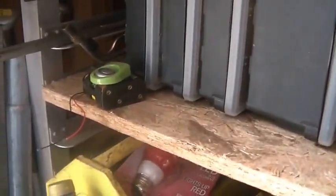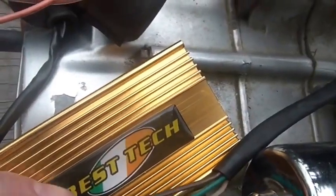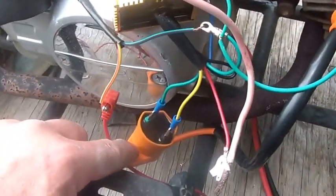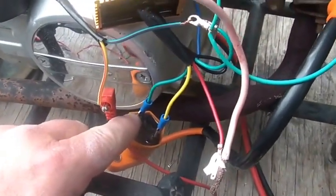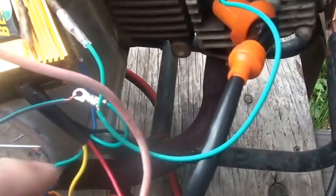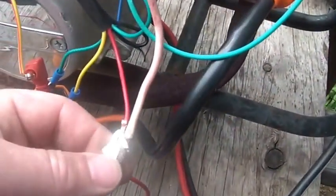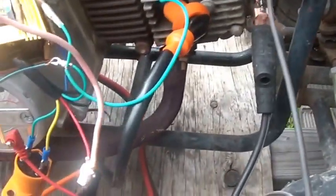I hope this helps, because some folks are going to end up with the Best Tech ignition system and I just wanted to hook it up so you guys could see it. For your spark coil, you've got to make your CDI happy. Yellow wire goes to the high side of your spark coil, ground on the low side. You've got to always have ground to body, and your ground is where you put your negative side of the battery. They ran two wires out of here for the pulsar, so I ran a ground wire back in. The blue wire goes to your pulse generator, red goes to plus 12 DC, and your grounds go to body ground. Hook up your spark plug wire and it should be ready to go.